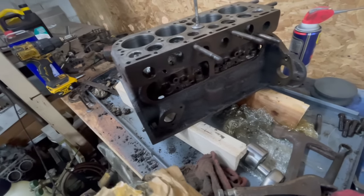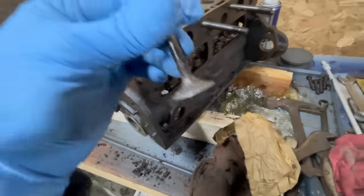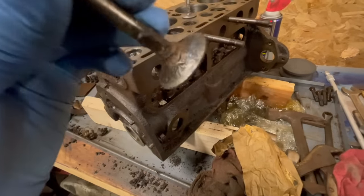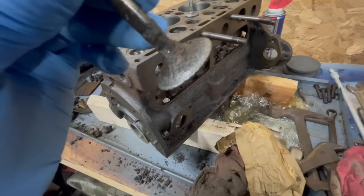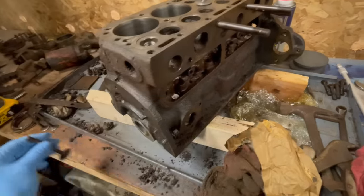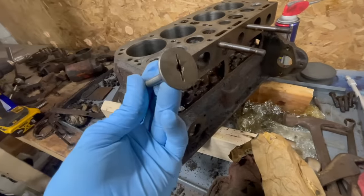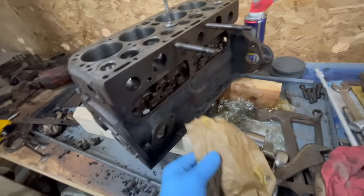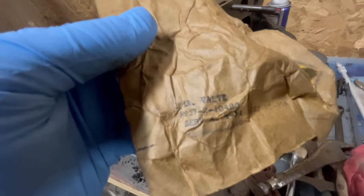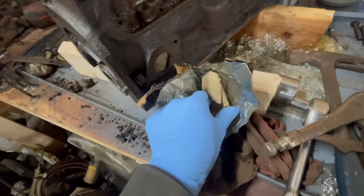But what is critical here is valves and sealing surfaces. Now when I pull up one of the old exhaust valves, you can see that that's just plain not usable. There's no helping that guy. So, luckily, fresh from 1951, still new in the package, see, service A4 of 1951. Still in Cosmoline, brand new.